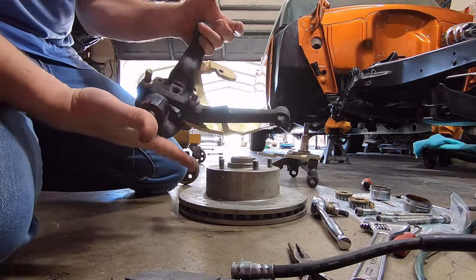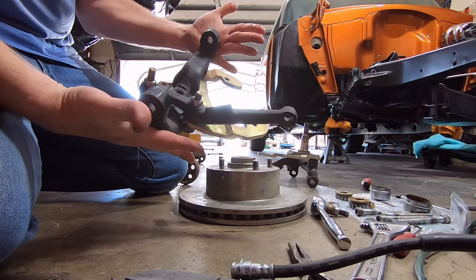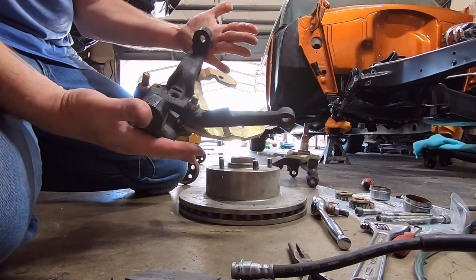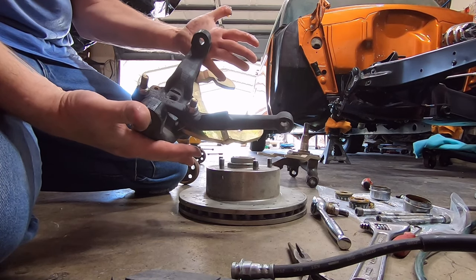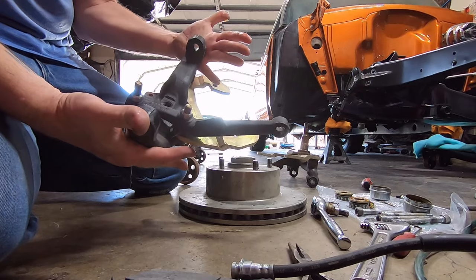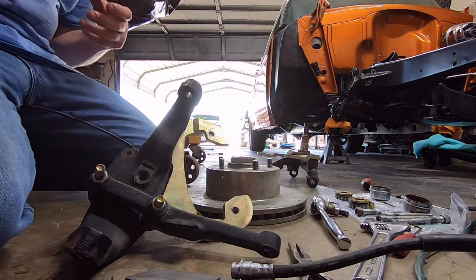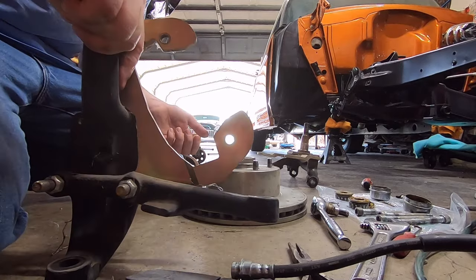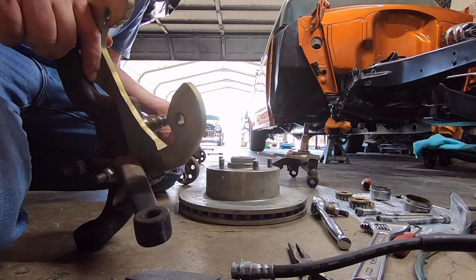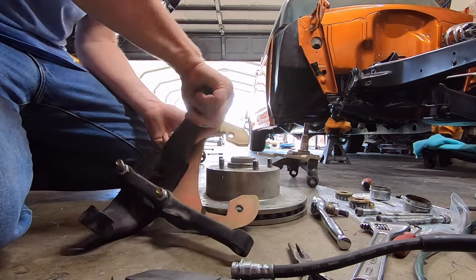The backside looks good, because that's probably when they had the frame blasted, they didn't unbolt anything. So they blasted it with the drums and everything on it, and then they put the disc brake kit on after everything, because they never took the chassis front suspension apart when they blasted it or painted it. So everything was done all together, and I found sand and a bunch of stuff. The steering linkage was full of sand, and where the pitman arm ball goes up in the center link, which was dumb. So anyway, I'm just going to clean these up real good,